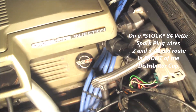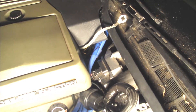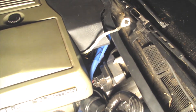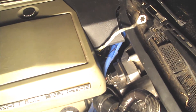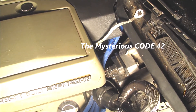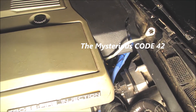Any of the spark plugs or secondary wiring that come off the distributor — if they come into contact with any of the wires that go to the computer, the electronic control module or the ignition control module, we usually get some type of false code or some type of ghost misfire, but mostly code 42. That's the big one that causes a lot of trouble coming off the wiring out of that ignition control module.